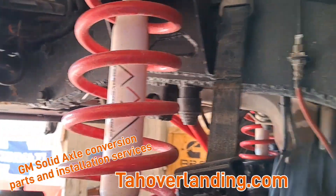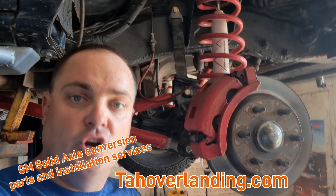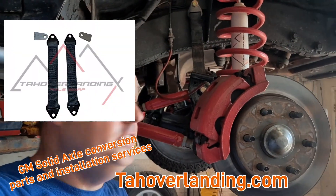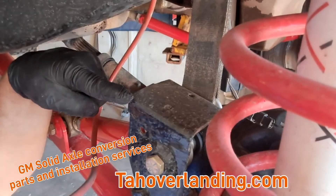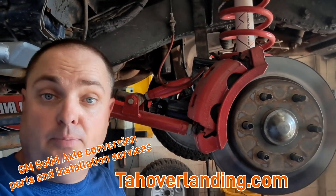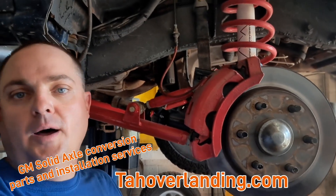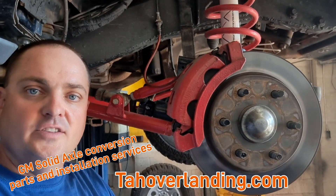Next up are limit straps. This suspension will out-flex and out-droop the shocks and springs by far, and shocks are not limit straps — you don't want your shock to be what limits your suspension travel, as it damages the shock quickly. We also provide the limit straps and the tab that welds on to the upper shock mount. That just ties down and shares a bolt with the upper locating arm on the axle housing. Limit straps need to be one inch shorter than the actual overall travel because they will stretch. I tested this — I put limit straps at the exact length needed, went off-roading once, and my spring popped out. So always set your limit straps one inch short so they can stretch to the final length and still not pop the spring out.